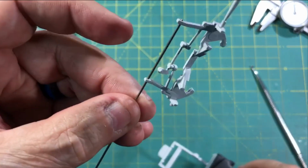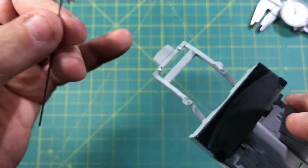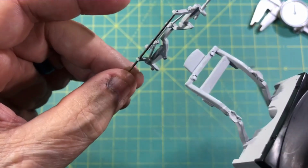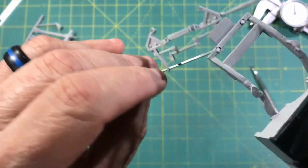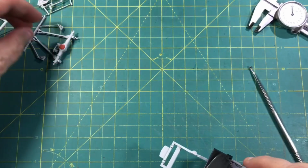And this will be painted probably in the morning. The center bar, which is welded to the chassis, or is actually part of the chassis, and then we'll mask that off and shoot the lower A-arms in semi-gloss black.